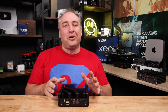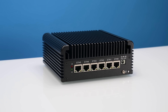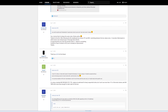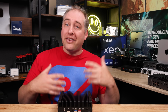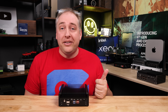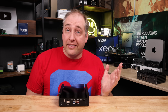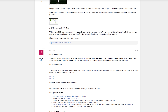Now let's talk about operating systems, because that was one of the most painful things by far. If you do go and buy something like this, I'm going to tell you to go look at the STH forums — they have great resources for this. One of the reasons we did this review is we had a user ask about this unit because they were having troubles, and we have such good resources that I thought I'd bring that out in a video. Hardware P-states are not enabled by default. There is someone that has hacked the BIOS so you can get a version with P-states enabled, and there are various power tuning options. There are instructions about all of that in the forum thread.